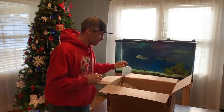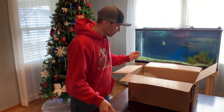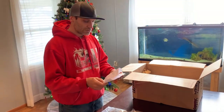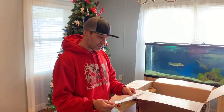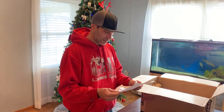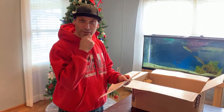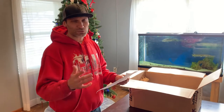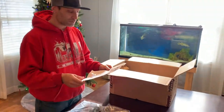We've got a couple of the muffler mounts — it comes with two, and we got both of those. We got the hardware and directions. Well guys, Trinity is a top-of-the-line exhaust, but the directions aren't really directions. It just tells you about the packing. You're supposed to check your packing at about every 15 hours of riding. Make sure you stay on top of that because if you run the Power Commander and your packing starts to go bad when it's mapped to that exhaust, it's going to throw off the fuel ratio. Definitely stay on the packing — anybody that's done any racing will tell you, keep an eye on your packing.